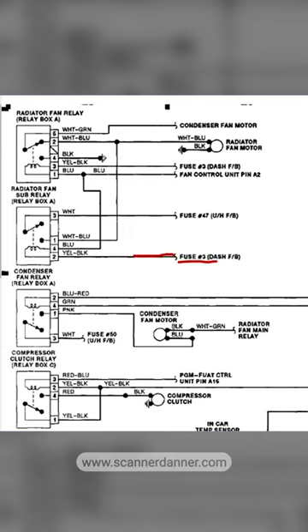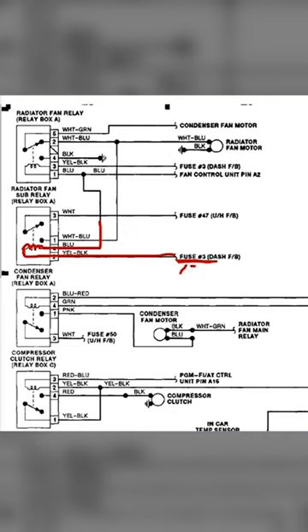If I were to follow this fuse and follow this wire, should I draw through that coil right there? You would never want to draw through that coil because if you did that and continued through, what did you just say to yourself about that wire? You're thinking fuse, which is 12 volts — so what are you thinking over here? You're thinking 12 volts still. That's where you've already failed in reading the diagram.